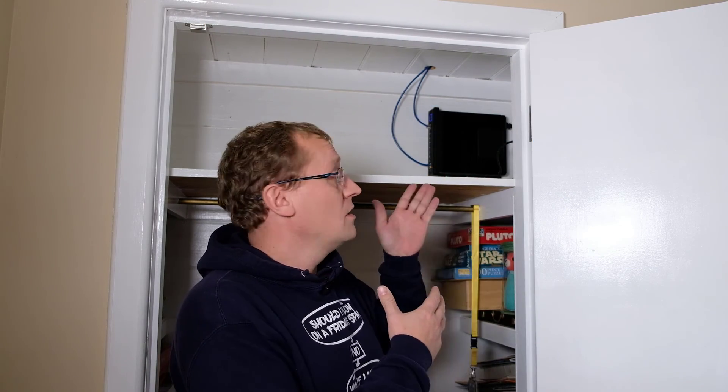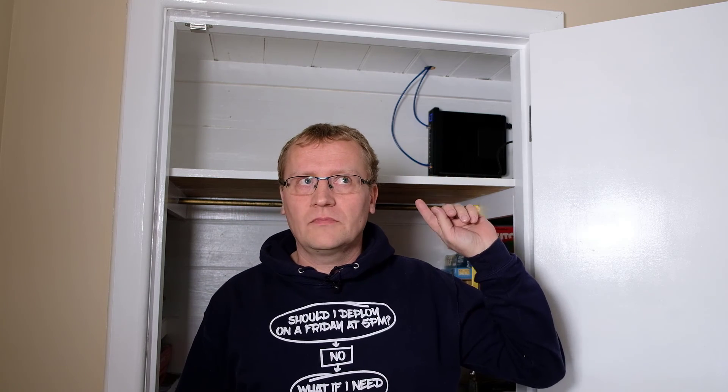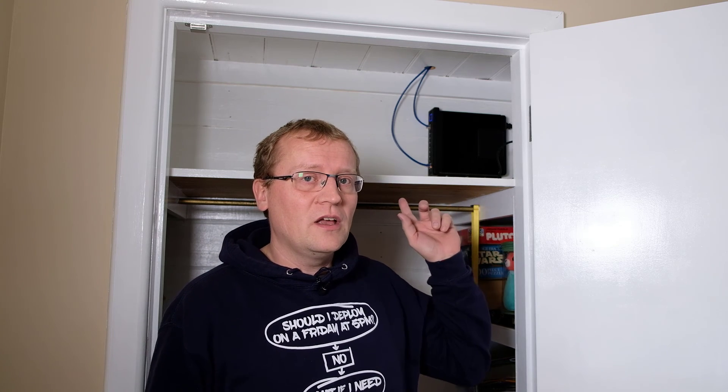The UniFi industrial switch is now hooked up to my switch on the other side of the house. I'm getting that 100 megabit connection instead of 1 gigabit — I think it's my cabling or crimping that's not quite up to scratch, but I'll figure that out later. This switch does do 1 gigabit, which means the access point will also do 1 gigabit. So I hope you liked this video. Please subscribe to my channel if you want to see more installation of networking stuff, Lego, cars, and home automation. Leave a comment if you've got other ways of doing this, or if you know why I'm getting 100 megabit and it's not the cabling — let me know. Thank you for watching and see you next time.